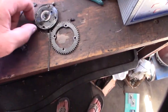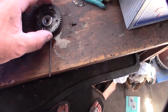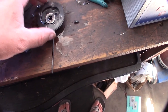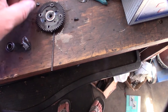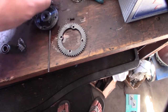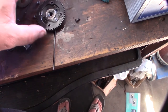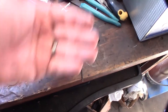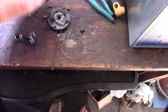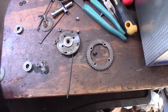I'm not sure, but this spur gear here doesn't seem like it's the correct one for this car. The holes are a larger diameter and there are lock threads, plus there was a piece of plastic in there to fill up the space and tighten it. I noticed it wasn't exactly concentric. Everything done here seemed half-assed, it was pretty annoying.